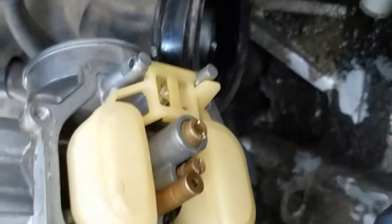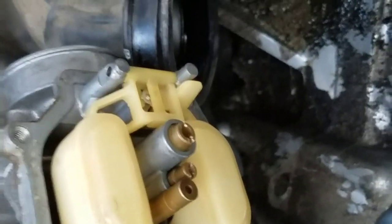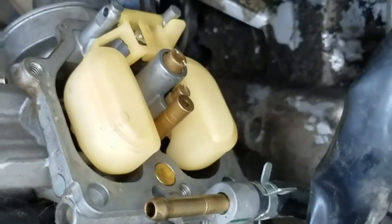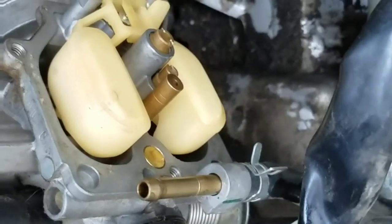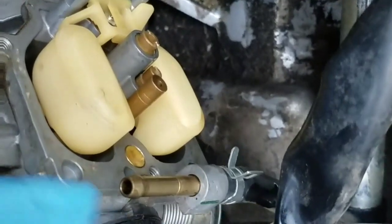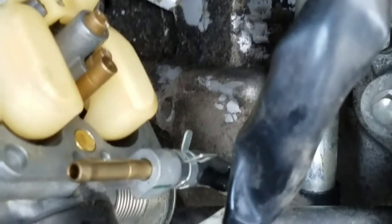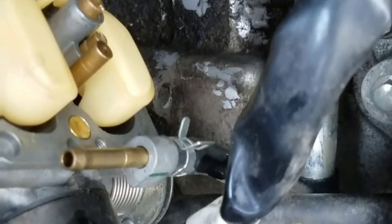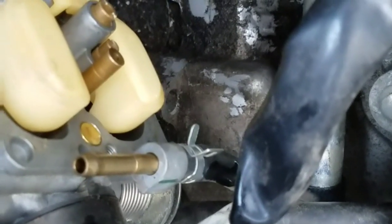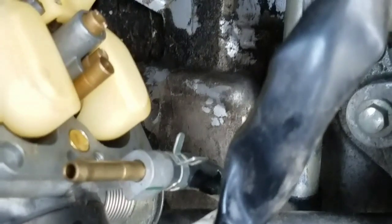Now with the 3 screws put on the bottom of that cup, see the 3 holes there, you put the 3 screws back in, and then we'll put this thing right back together. Like you see right here, the hose on the right here, that's your other coolant line. So there's a coolant line on each side. One's still connected. You can see the clamp on the other side of that. And I'll put the other one back on. There's very few things I disconnected, and so we'll go from there.